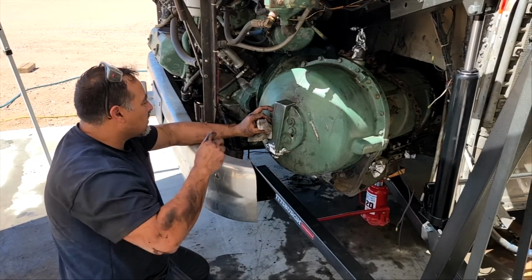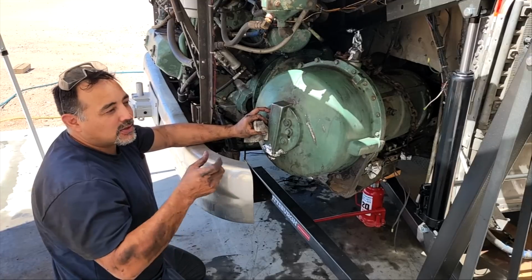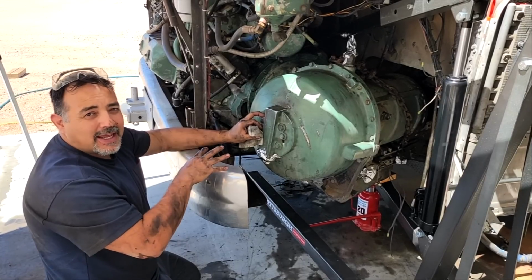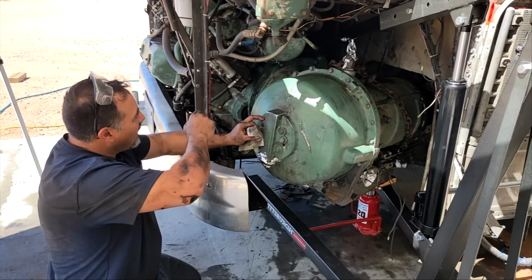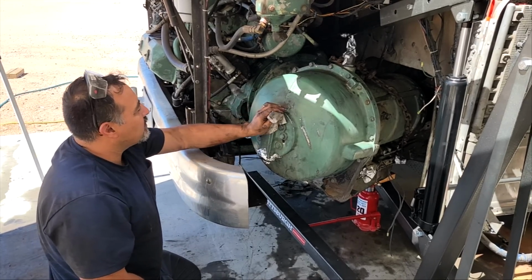And we've cinched them all up, got them all replaced. We did follow the procedure on the Right Stuff thing, which said let it sit for 60 minutes just at hand tight. After the 60, we went and ate lunch. Then after the 60 minutes, we came back through and just torqued everything down. And so it's nice and tight now, so it should be secure.